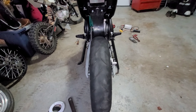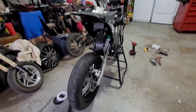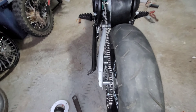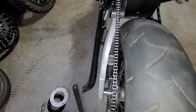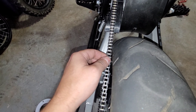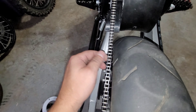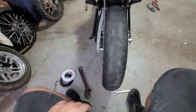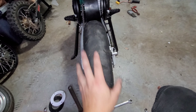This video is a follow-up to the tire swap I did on the B1, where I ran a 100-wide in the rear. Unfortunately, with these hubs being so skinny, the 100-wide doesn't exactly fit. You could probably run it like this, but as you can see we are actually bending around the tire and rubbing really bad. Stock as-is, you could probably only fit like a 90-wide on it.